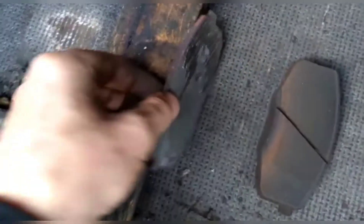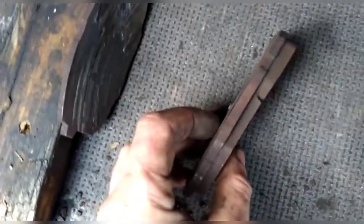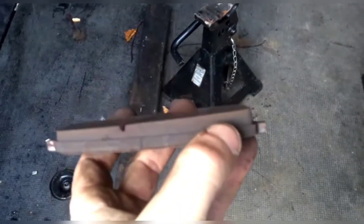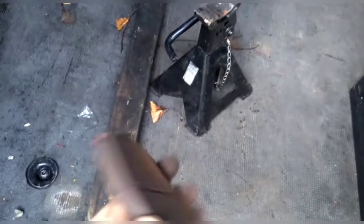If you look here, this is the brake pad from the inner side of the disc and this is the brake pad from the outer side. You've got uneven wear — this one is down to the rubber on the metal, and this one has got life left in it. But you can see it's slimmer on this side and has more meat on this side, so it's wearing unevenly from top to bottom because of that stuck slider.